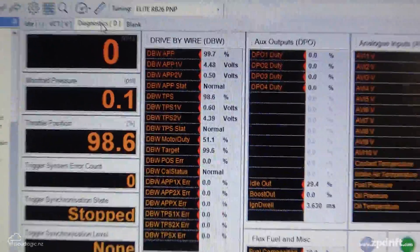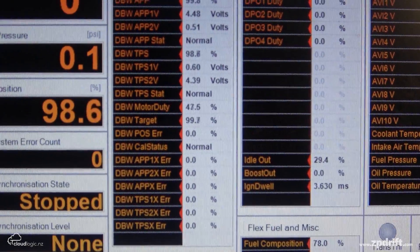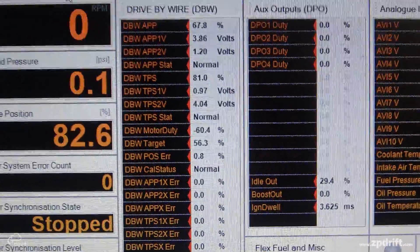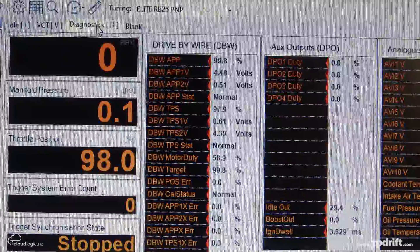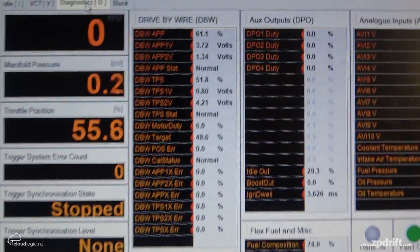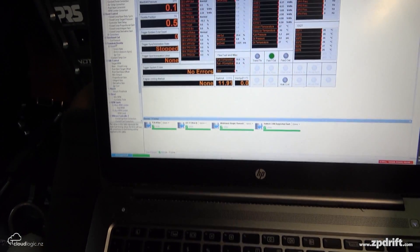This hasn't been dynoed yet, so this is just set up to work on the car. The drive-by-wire TPS has two outputs — there's the voltage and the motor duty. What I've noticed with the DBW motor duty is when I open the throttle it goes higher and then sort of drops off a bit, which I assume is the load or output the drive-by-wire motor is doing. Either way it works, and to my liking it seems to work nicely. I've also been playing around with the idle settings.